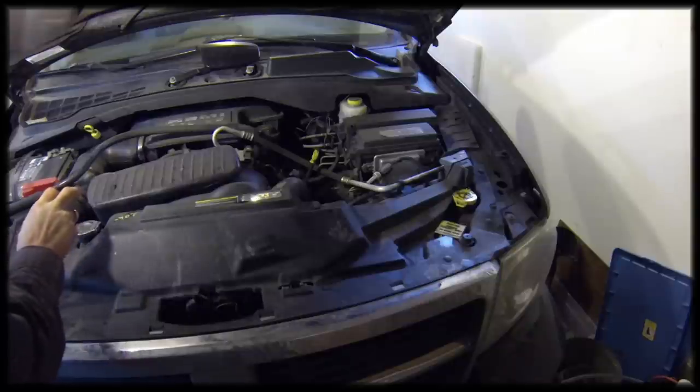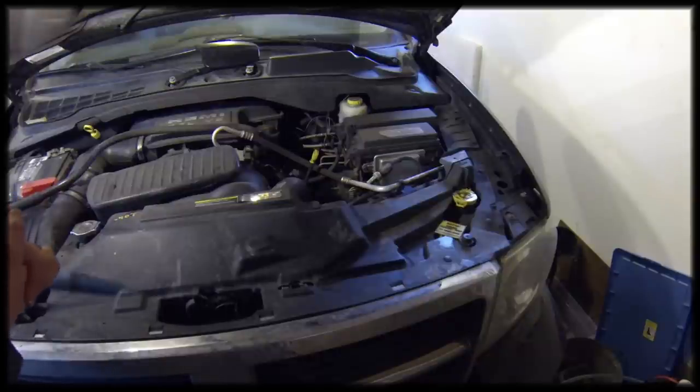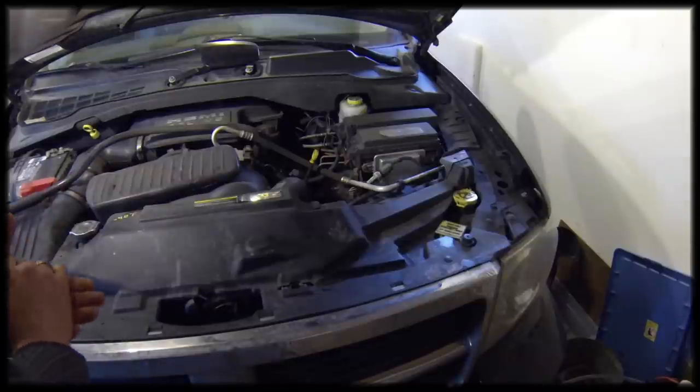After that I'm going to check the temperature protection using a coolant gauge you can get anywhere. Since I'm in Minnesota, I'll probably go down to negative 40 or so. Then once again, check and make sure I've got enough coolant in the reservoir, and that should do it. Thanks for watching.